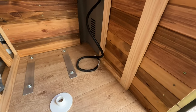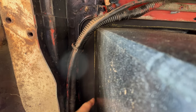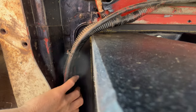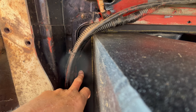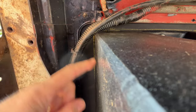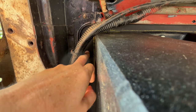and see where it comes to under here. So I'm underneath the very back of the bus here. This here is my grey water tank. And you can see here, this little bit of floor between the tank and the steel subfloor frame of the bus is all the space I have to drill that hole from underneath. Obviously, I have a little bit more space above the floor to fit that big flange, but the actual hole needs to go somewhere in here.